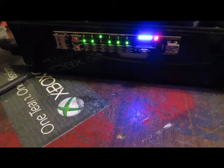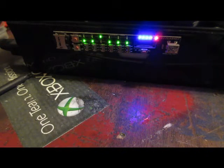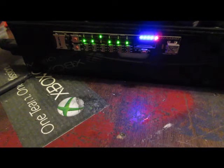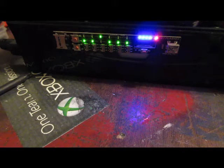I guess the other tenth of the issue could be that maybe something's wrong with your flasher, or maybe when you attached it to the head unit, I guess this is the head, but the main unit, if it's attached there properly, then we can basically assume it's going to be something either with the flasher or with the clip. And like I said, 9 times out of 10, it's with that clip.